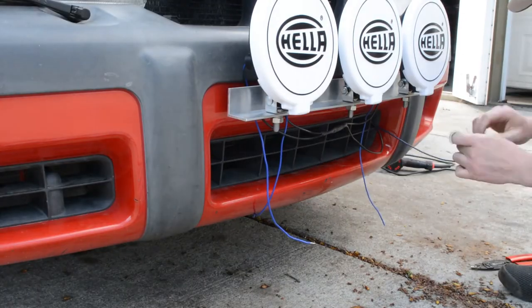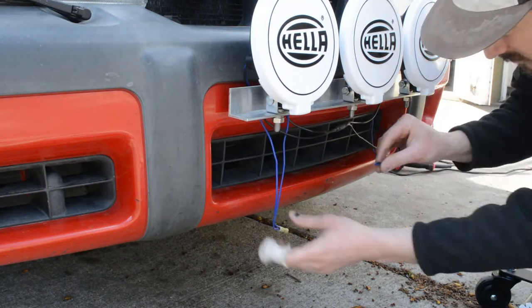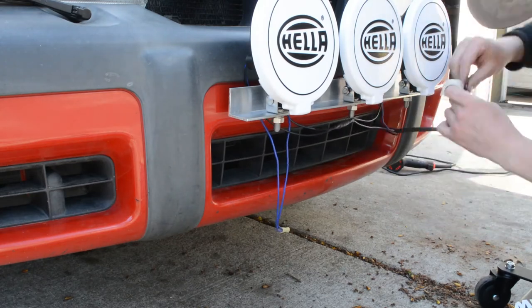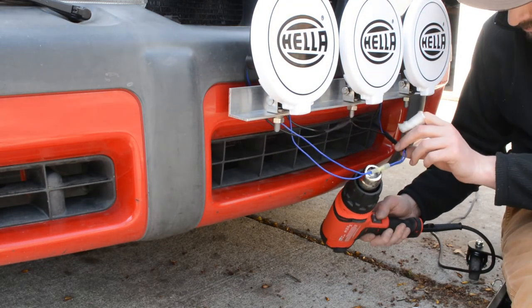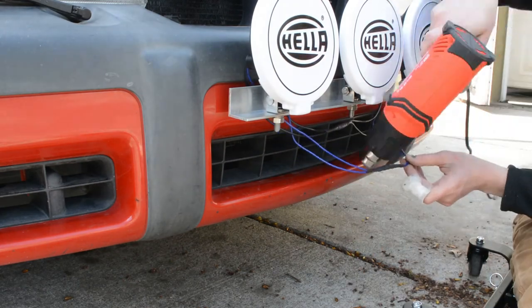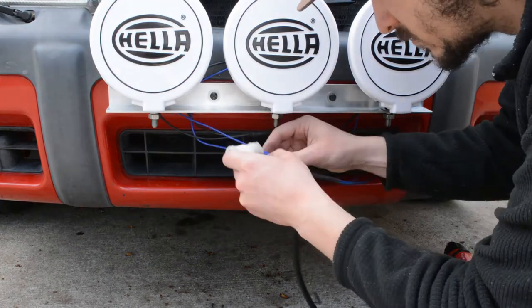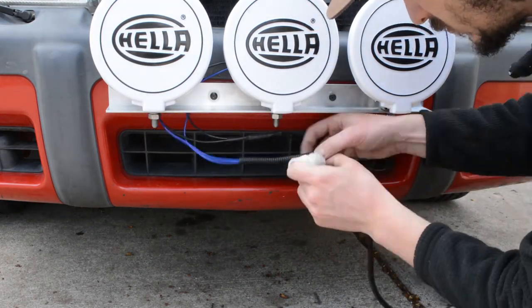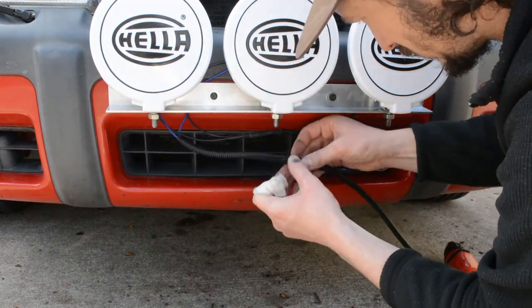Once I finished I realized I was unhappy with some of the routing — some wires crossed over each other in a way I didn't really like. I don't think it ruined the setup and it still looks really clean, but just be aware of which wires are crossing what and how they're being fed so when you connect it all you're happy with how it's run. I used wire loom on the front end to clean up the wiring a bit, then zip tied it up around the bracket — you can't see the zip ties behind the fog lamp and it looks really clean.